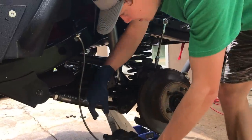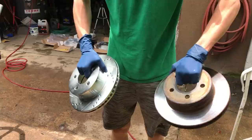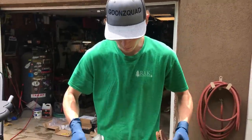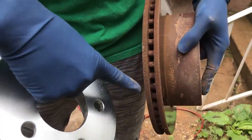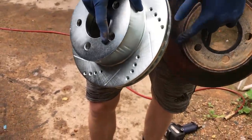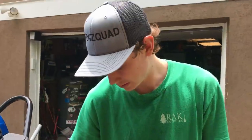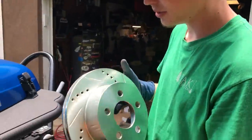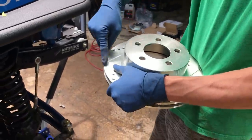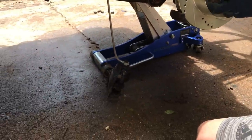These brakes can hang — they've got nice braided lines. That's how simple it is: just take off the original ones. These are the drilled and slotted — they feel about the same weight, nothing much different. As you can see, drilled holes go through into the center. On the stock rotor it only cools from the center, but with drilled and slotted the air it catches is gonna cool the pads off on the face of the rotor too. There's a forwards and a backwards — the way to put these on, with the slots in a spiral, you want that to be facing forward, just like this.